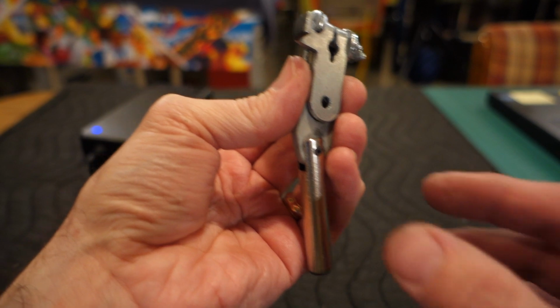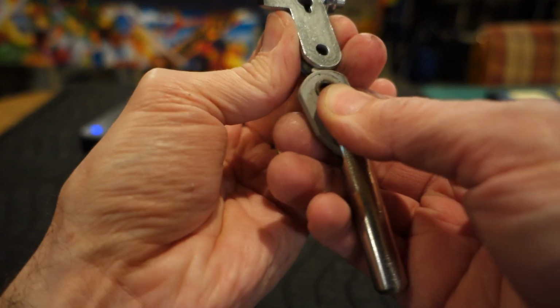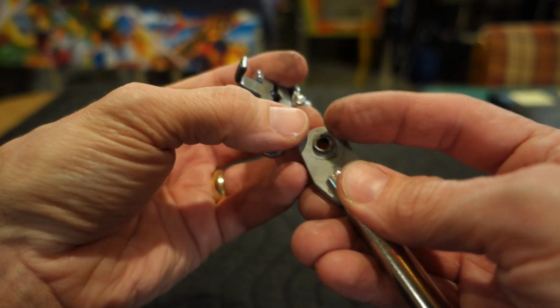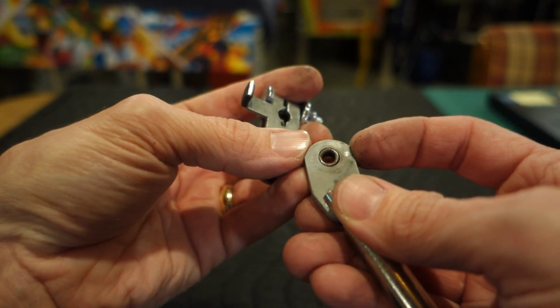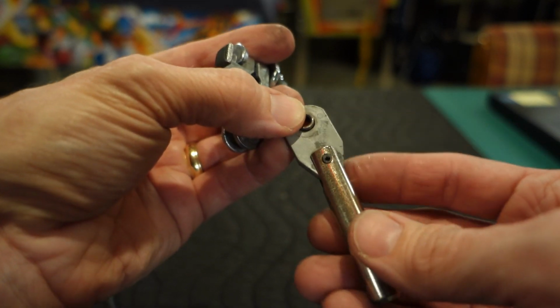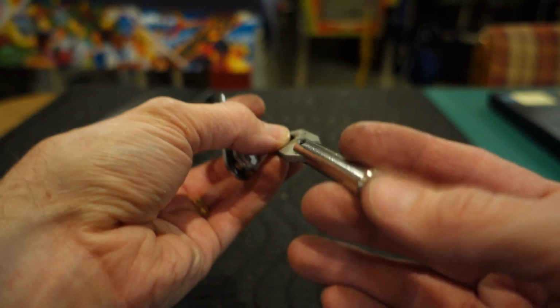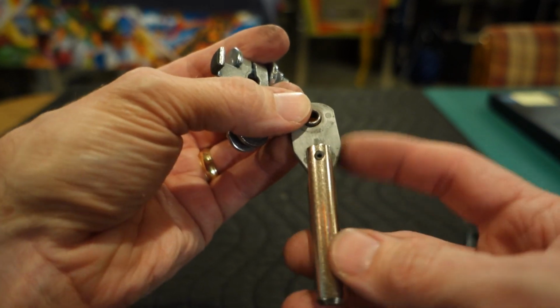Here we are at the table, and I pulled out the bolt. And as you can see here, there is a ton of slop in here. It's just really loosey-goosey hanging out in here. Because this really isn't worn at all, it's not mushroomed at all, just some of the chrome starting to come off the bottom, I'm not going to change this bit.